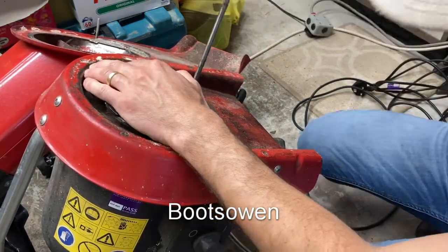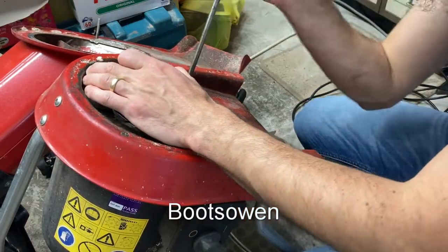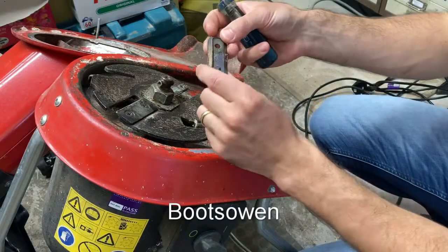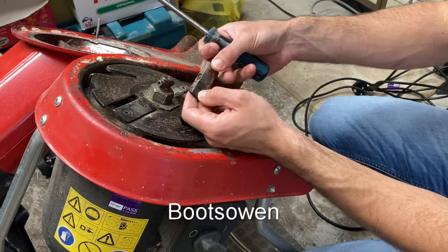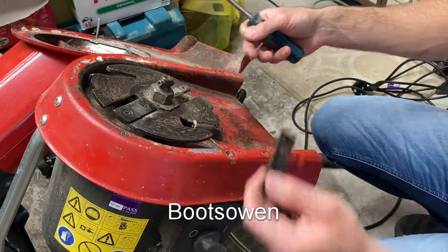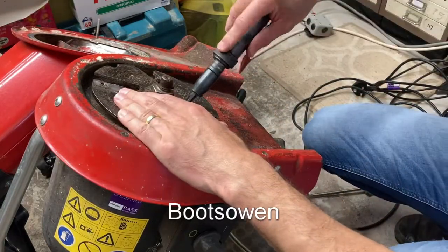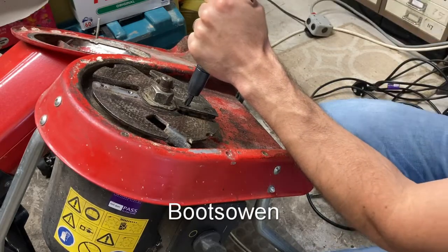This one is stickier. I'm not sure why. Does the outside one do more work? Maybe? Stuff's getting thrown to the outside. Possibly. That's blade number one. It has a part number on it, 384985/00. The other side actually just feels sharp, so I'll give that a clean and try it. It's so blunt that I can actually just rub my fingers along it. And I have a feeling you could probably resharpen these as well, as long as you did them in pairs, just like a planer knife.